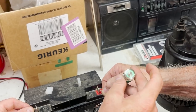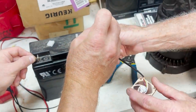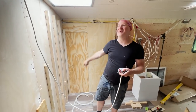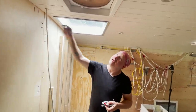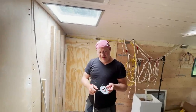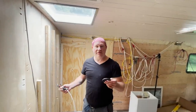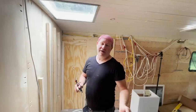We're getting the electrical components ready for the 12-volt fan. It's like a computer fan where we'll wire up a plug to plug the power in instead of hard-wiring positive and negative right to the switch. We tested it and confirmed it's blowing toward our fingers. When we put our wire runs in the ceiling before we put the ceiling up, we had planned a fan circuit of 12 volts, so we've got our power run ready because we knew we were going to put a fan in the composting toilet. It is Kildwik's 12-volt fan set — it's got a very hefty stainless steel mounting so we can put an exhaust hose past the fan and keep all those unpleasant odors moving out of the vehicle at all times.